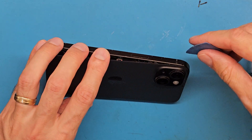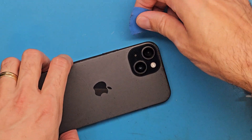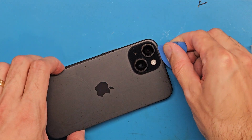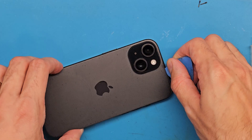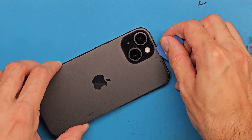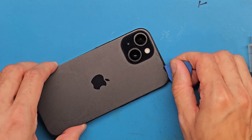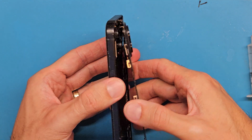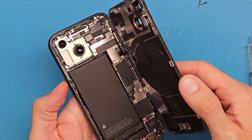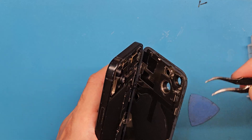Now I am gently working my way up and pulling on the back cover. I am pulling away, and while it's opened at this angle I am able to detach the back cover — only because it's pulled away. We have about a 2 mm gap here. I'm pulling away and the phone is at an angle; that angle allows the metal clip to unclip. Gently, because we have that wireless and flash flex cable. These metal clips keep everything in place.